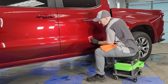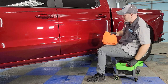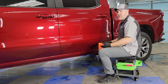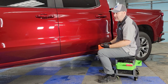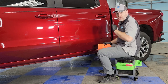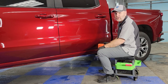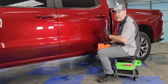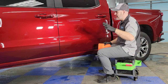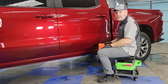You will see what I like to call a visible flash of the solvent and the coating between 30 seconds to a minute — a very visible flash of the coating. You can level it and take it off immediately after that flash hits if you want to. You don't have to wait. But if you have a crew or you're a detailer that likes to apply across several panels at a time, you can simply do that.